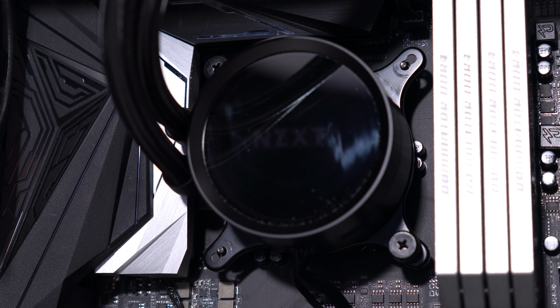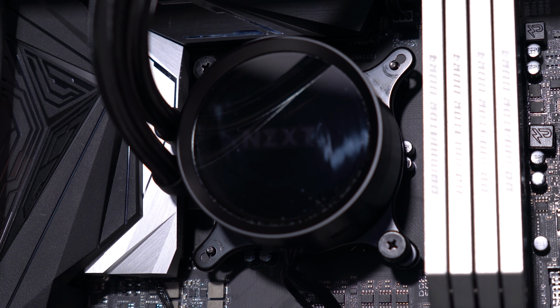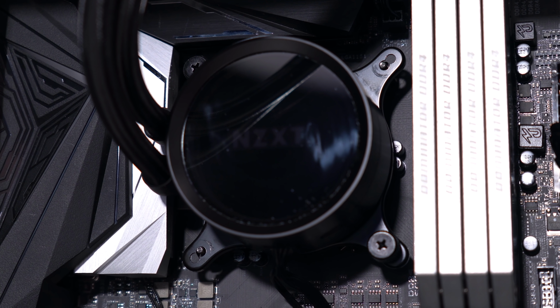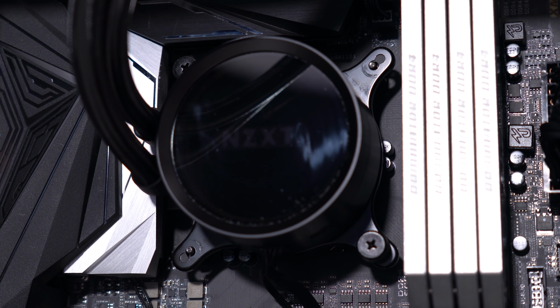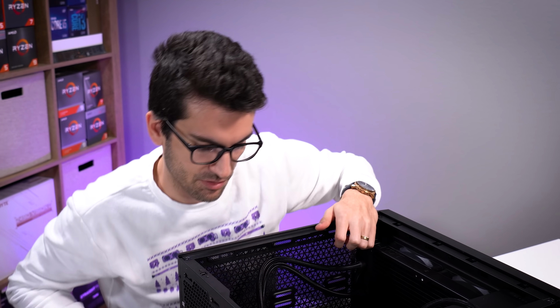I wonder if that's the case, because at least here we have a somewhat even distribution. What's going to happen is the thermal paste is going to spread across from the middle, like cutting diagonally through the IHS. I think we still might have decent coverage. I'm worried about mounting pressure on the opposing ends where there aren't thumb screws. I'm not sure how that's going to fare.